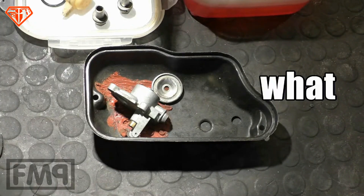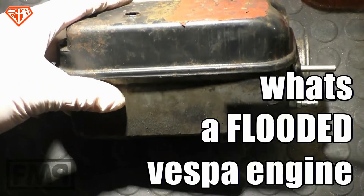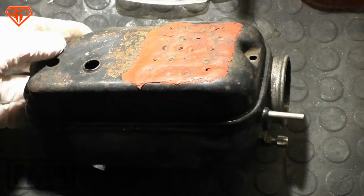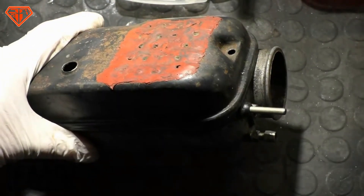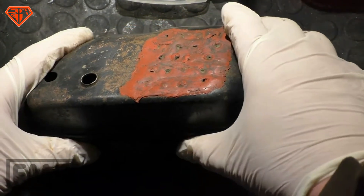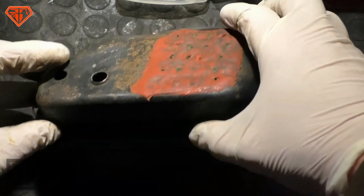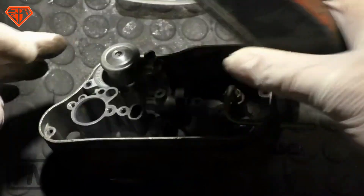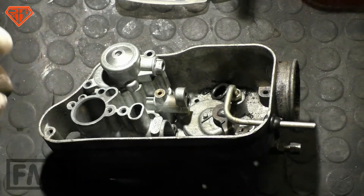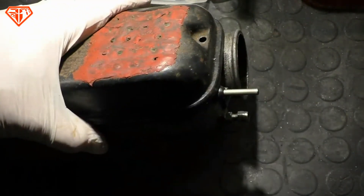Cheers guys. Carburetor casing — a speciality of Vespa engines. The carburetor sits in a closed case. Usually there are rubbers everywhere and it's a closed room, connected to the frame where fresh air comes in from the hole under the seat. What does a flooded engine or drowned engine mean in the case of a Vespa? It does not mean that the engine intake is full of fuel. It just means that the air in this closed casing is too rich.